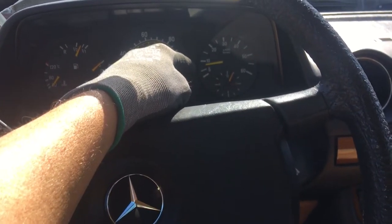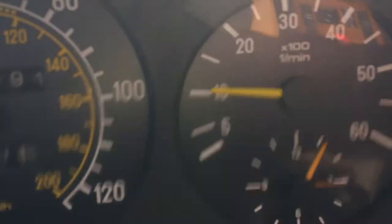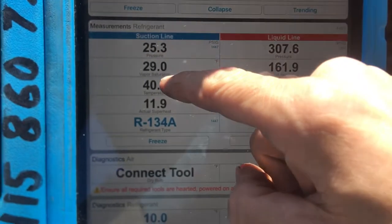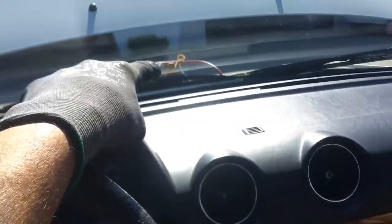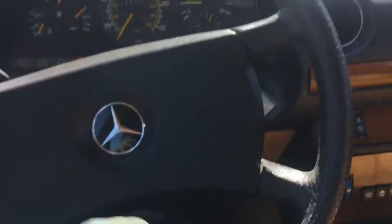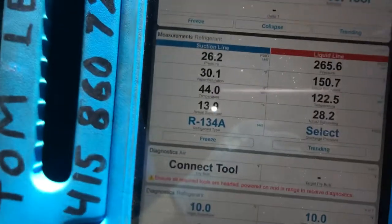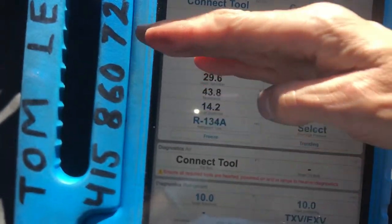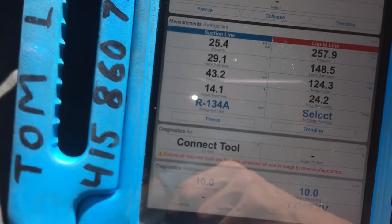Diesel engines do not move like today's gas cars — I pushed it like two and a half inches to get it to move a little bit. I've got it at a thousand, and the diesel turbo is taking off on me. Now look at our temperature: this is our suction line going back to the compressor. The yellow wire — my temperature sensor — is not insulated and is in the hot air stream of the radiator and condenser, and it's still pulling this temperature at roughly a thousand RPMs. We can watch our expansion valve modulate up and down as it moves, so we know there's movement and it's working.